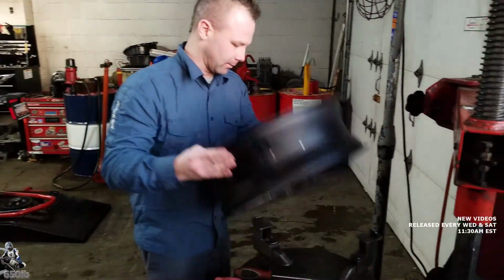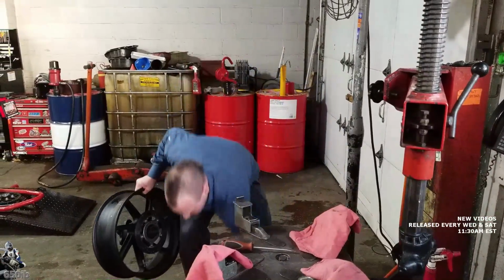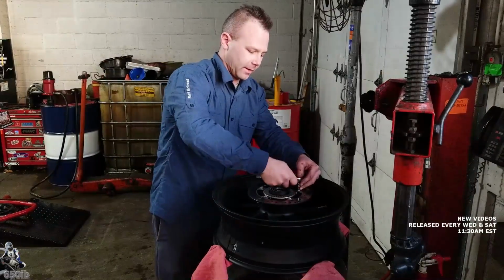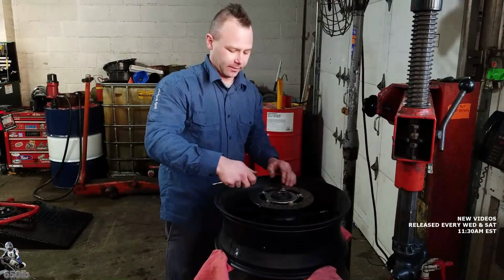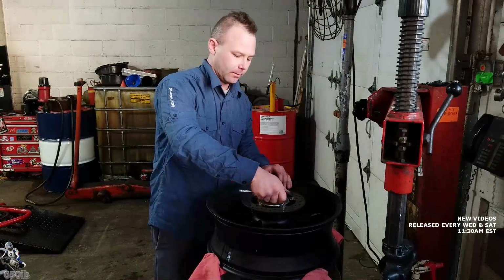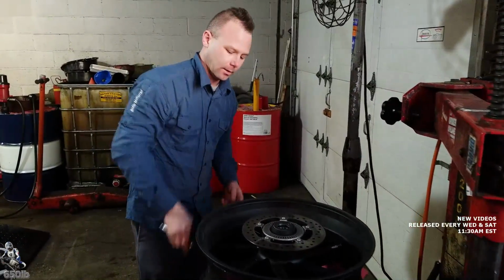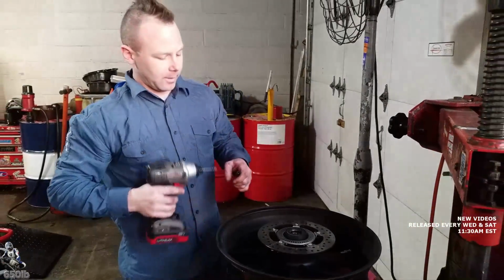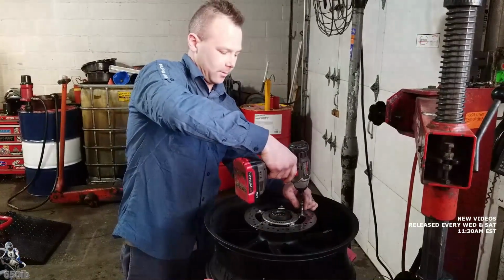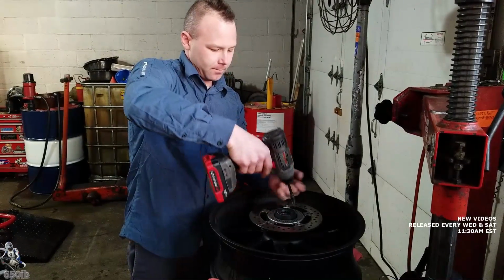Nice. Oh, losing the rags. We'll just top the rotor off, and this will be all ready for cleaning and paint. Anything that's flat and you want to stay flat and has more than one bolt or two bolts in line, you always want to just go in a star pattern. Okay. So it doesn't warp, and break it free in a couple steps, and then once it's broken free, you can go ahead and just remove them in whatever order you want. Okay. It's just the initial sequence.